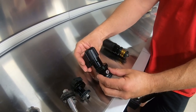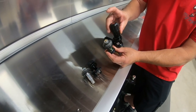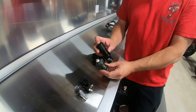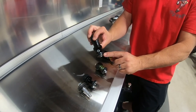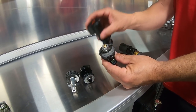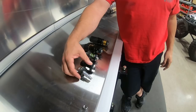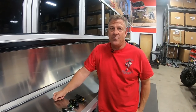This is an IQS — Intelligent Quick Switch — an electronically adjustable compression system. It's very similar to the dual speed adjuster, but it adjusts high and low speed together; you don't have the option of separating them. This system flows 10% more oil at the extremes of its adjustment range, so at its softest it's 10% more plush and at its stiffest it's 10% more stiff than a comparable manual adjuster. And for all the YXZ guys — we now have IQS available for the YXZ, so you can adjust that car on the fly electronically.